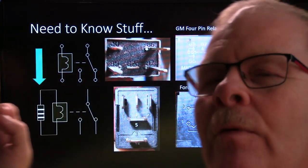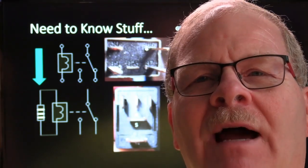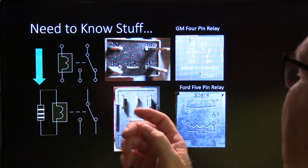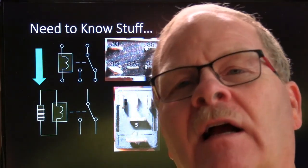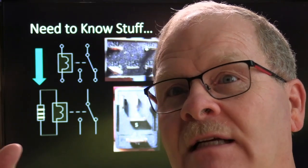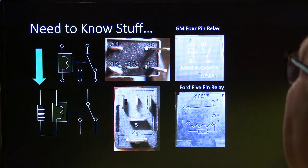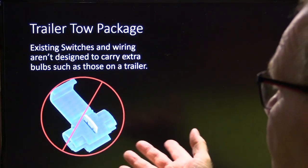Both of these show a clamping resistor. The reason they don't put a clamping diode in there is that if you plug the relay in backwards or it's wired wrong, it'll fry up something. So they put a resistor in there, which has basically a very similar clamping effect to a diode. Like on an AC clutch — whenever the magnetic field on that coil collapses, it creates a spike. That's one of the things they're trying to prevent. But like I say, some of these relays will show that they have that resistor but they really don't.